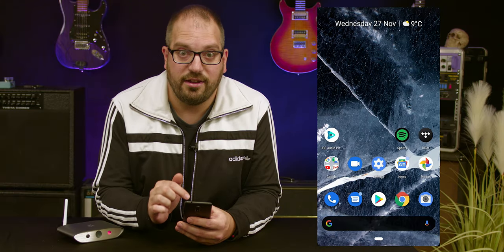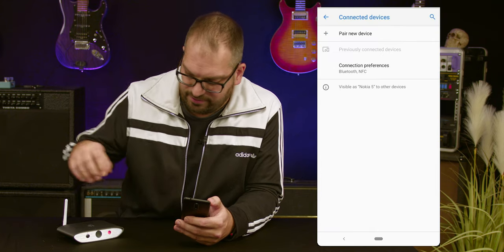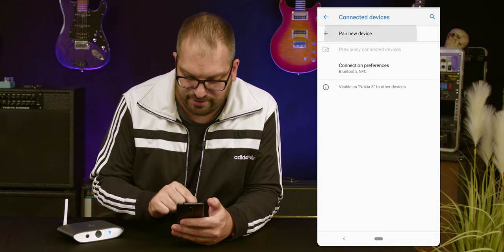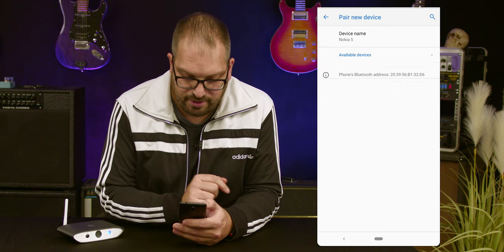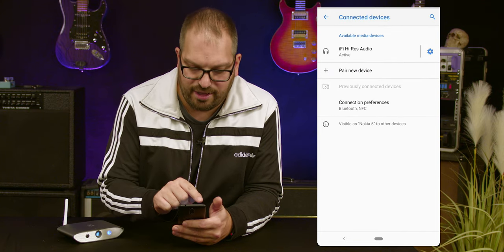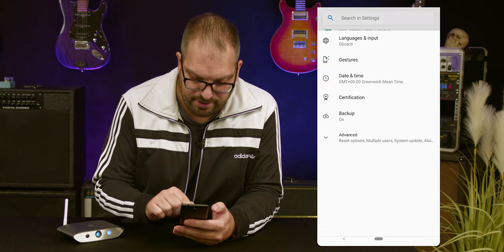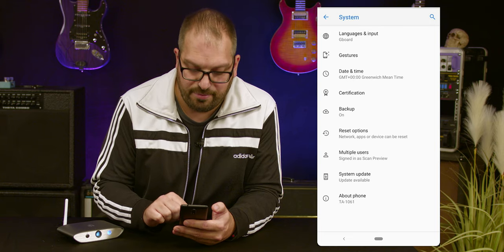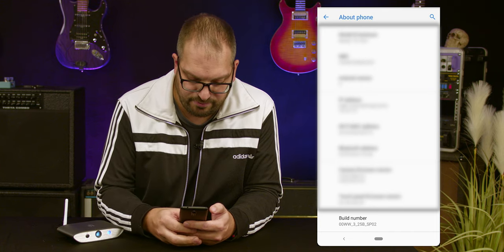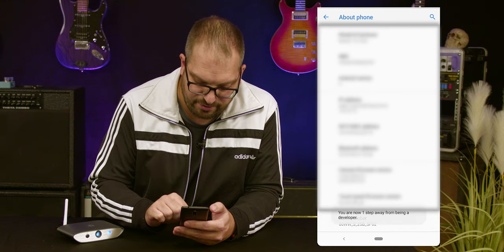So I've got a device here running Android Pie. Go into settings and let's pair the device. To do that, hold down the connection button and you can see the light is flashing — that tells me it's in pairing mode. We've picked up iFi Hi-Res Audio and that's now active. To make sure we've got all the settings we want, go to System and unlock what's called developer mode. Click on About Phone, scroll down to the bottom, and where it says Build Number, tap that seven times and we will then unlock the developer settings.